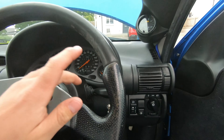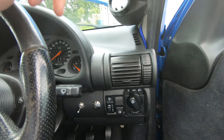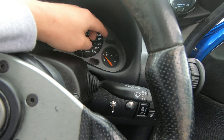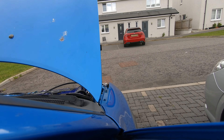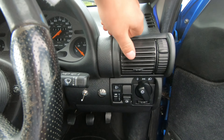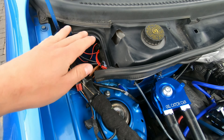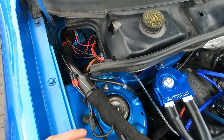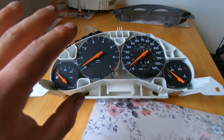I've installed the radiator fan on a switch. The reason I've done that is because on Vauxhalls the fan kicks in quite high, and I don't want the car to overheat or boil over — I'd much rather have full control. I've also fitted an inline fuse so there's no issues. I'll show you: there's the wiring, yes I need to tidy it up since I've not long installed it, and there's the inline fuse. The wire goes around and down to the fan.